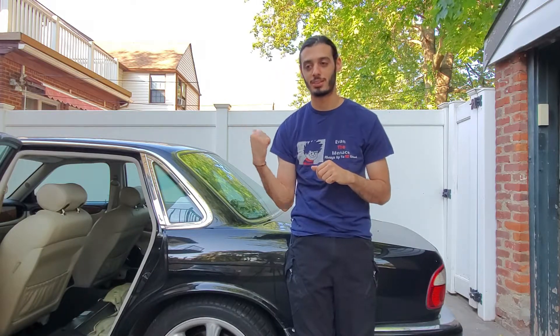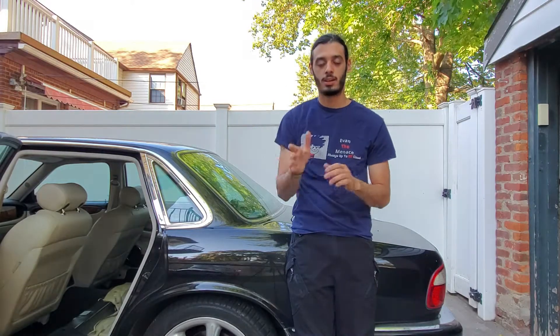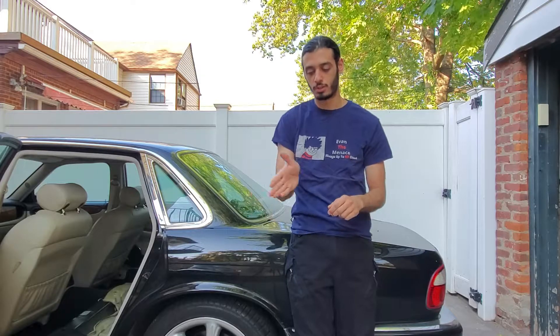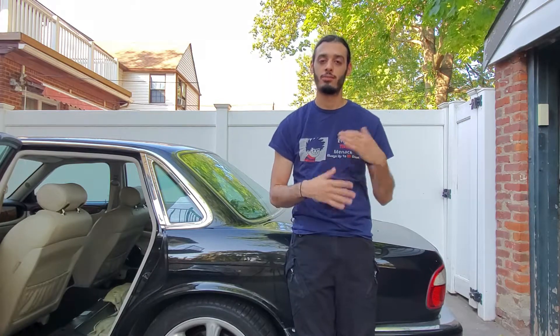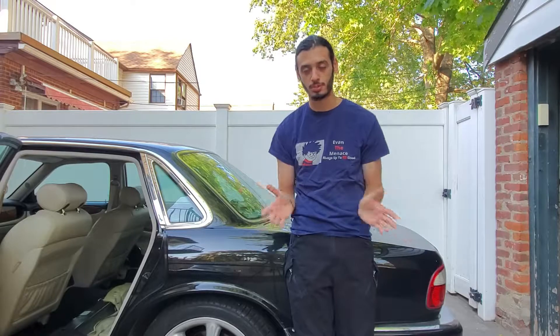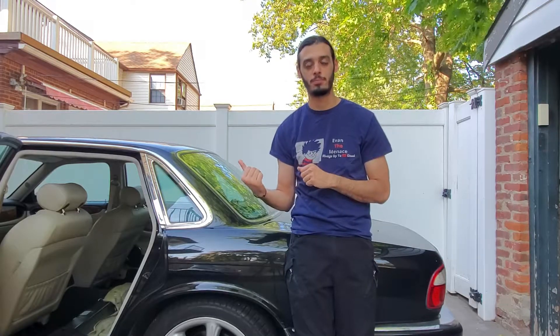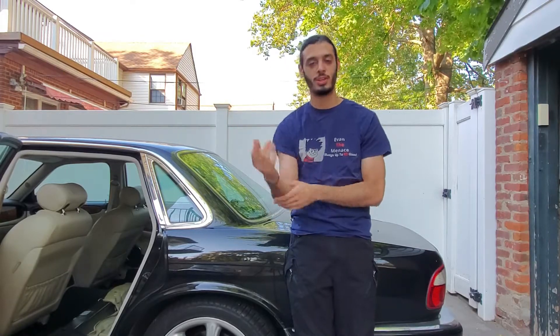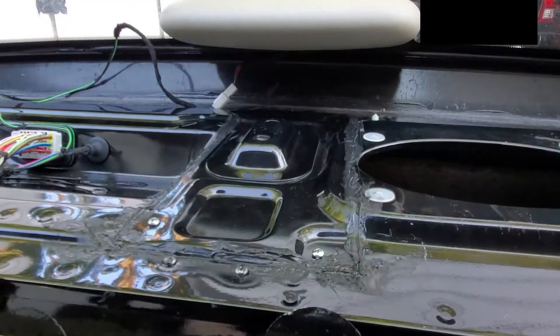That's why the seats are out. I decided to do it the small way by picking the back seat. I went ahead and cut the rear deck, making a square cut almost like cutting a fuel trap door — similar to how you'd cut an access panel on a Camaro or a truck bed to lift it up and get access. Let me bring the camera in and show you guys. Hopefully you can use this method if you need to change the fuel pump or the wires without taking the tank out.